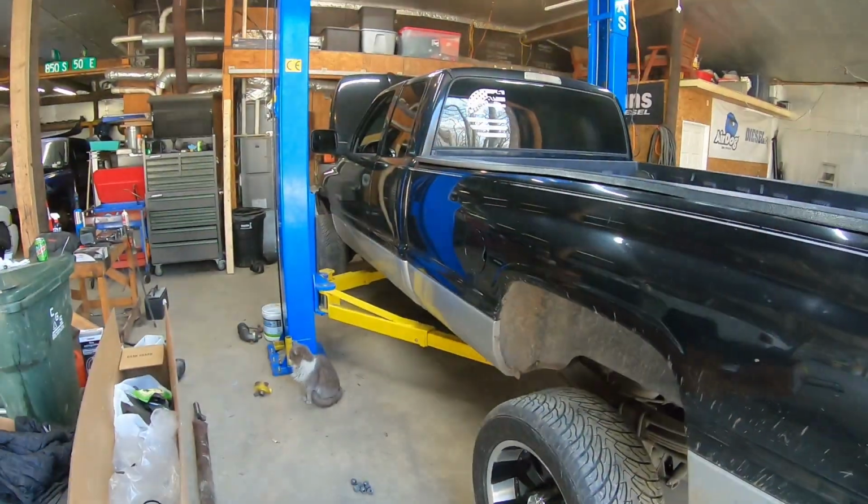Okay, guys, I just got back from Eli's house, the guy that was here yesterday with the 12 off truck. I took the ECM off of this truck and put it on his, and on his truck it revs up fine, no check engine light, everything's good. So at this point I personally think it's the VP44.